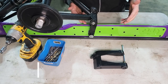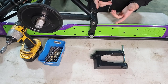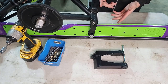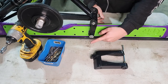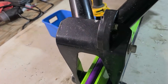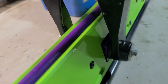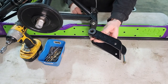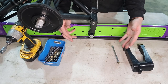There are a couple of things that make this whole system right in here a little bit weak. I've never actually seen one of these mounts fail in person, but I've seen lots of videos and pictures of them going out — whether the whole casting cracks, or generally what happens is these bolts will back out or the plate will fail within the mount. But we addressed that already. The whole rear suspension takes a dive — I've heard it screwing up the rail, screwing up the track, everything in one go. So before that happens, we're going to upgrade with this ZRP scissor mount.